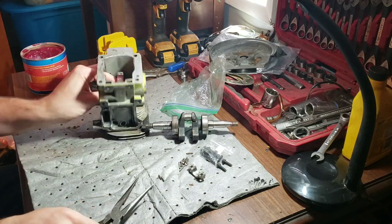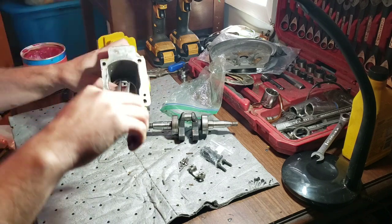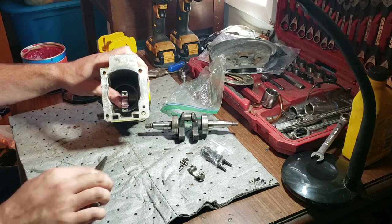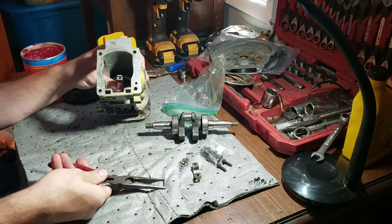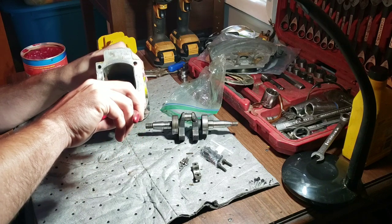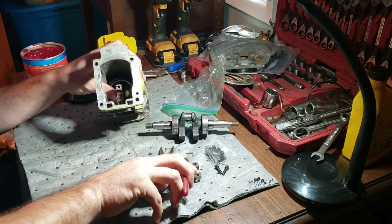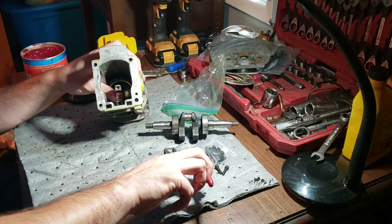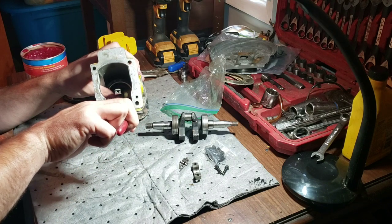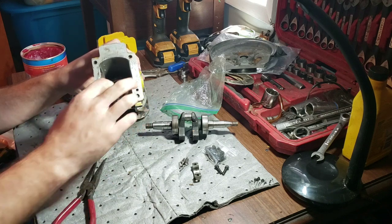The D44 has 22 needle bearings - the rest of them have 23, so good knowledge to know for future reference. We're gonna do this one at a time and show you guys the process - painfully 11 times on this side, then on the cap doing the exact same process. We're also gonna replace the rod bolts with monster rod bolts. Here's the factory ones and here's the new monster 12.9 - might be overkill but I doubt it's gonna make that kind of power to snap those. A connecting rod would be first to go.